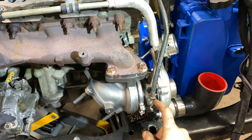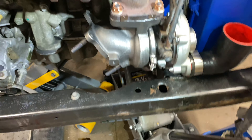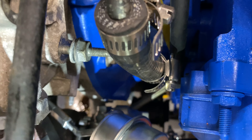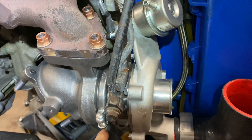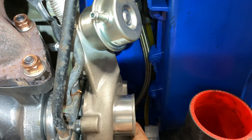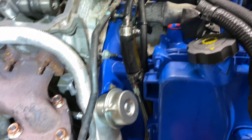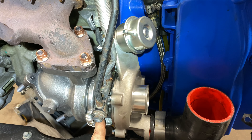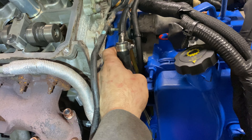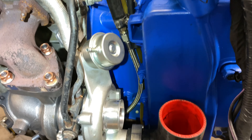You are going to have to bend your main coolant line. Now, it does not have a port on the bottom like the factory style. They actually give you a banjo line with a metal section that then turns into stainless. You've got a stainless line, and then you actually have to cut your existing line that normally runs to the front. You're going to have to cut it, and then I put a really hard bend on it with a pipe bender. They give you a heavy-duty hose, so I have no doubts of that holding, but there's a little bit of fab involved.